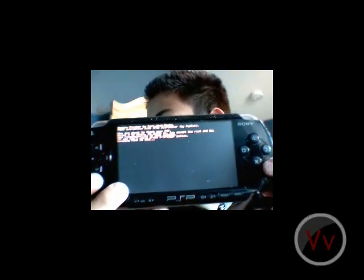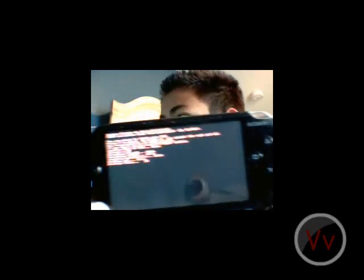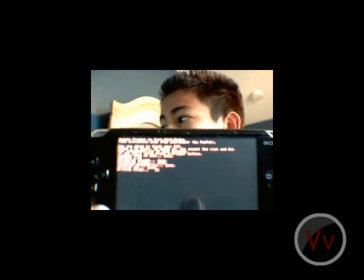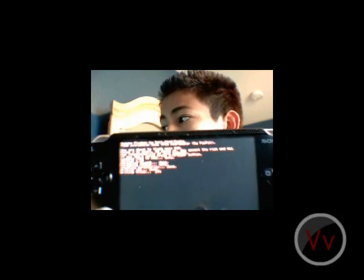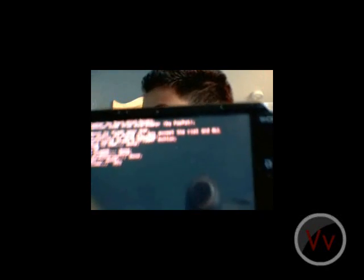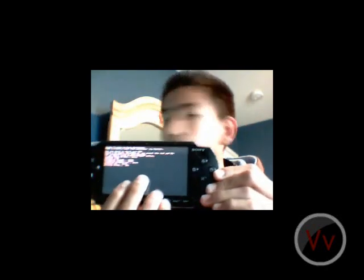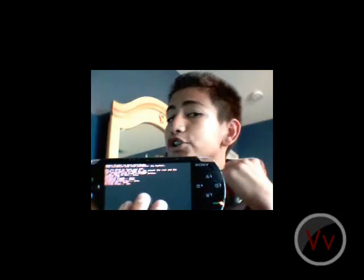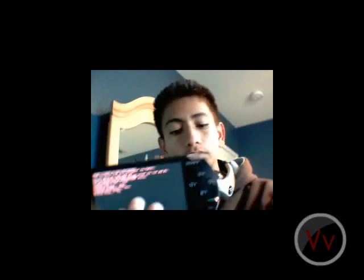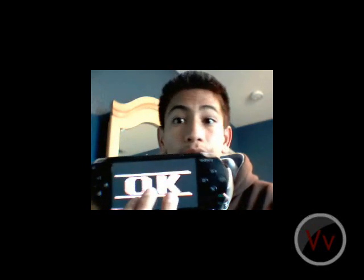Okay, it's running now. It's going to flash everything - delete some stuff and then flash some other stuff. The percentage is going up: 35, 36, 37%... it's going through percents right now. This is going to bring me back down to 1.5 firmware. From 1.5, you can upgrade from there to different firmwares. The reason why we made the Pandora's battery and magic memory stick in the first place is so you can get any official firmware on a custom firmware without having to go from 1.5 and downgrading.